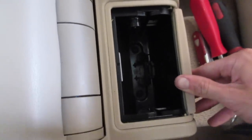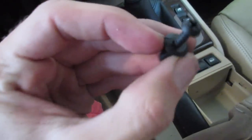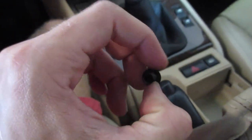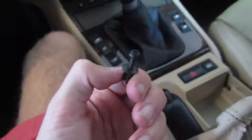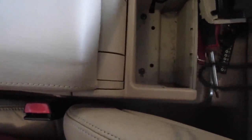If we open that up and push it down a little bit further, the ashtray will pop out. Let's remove the ashtray and set that with our other parts. Below that we're going to find two Phillips head screws — let's remove those first. A little note on those Phillips heads: they look like this and they're actually little clips, not so much actual screws. With those out of the way, we should be able to simply lift up on the rear ashtray and remove it.